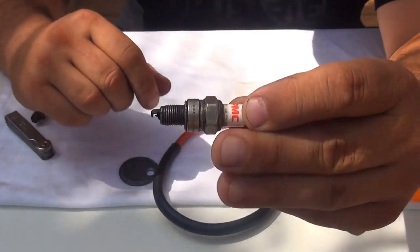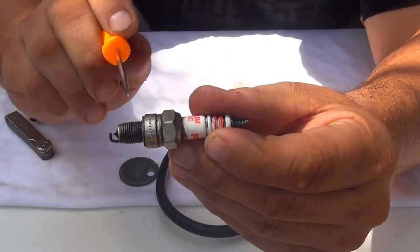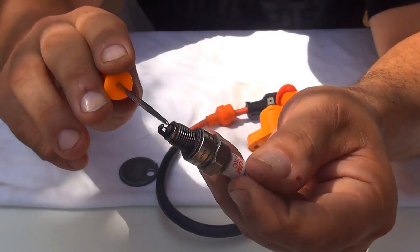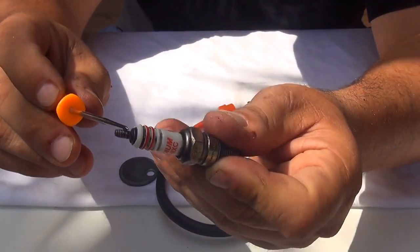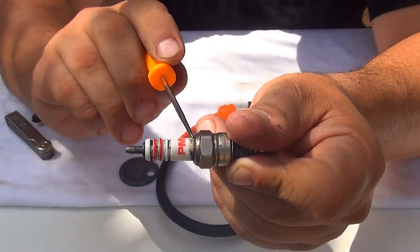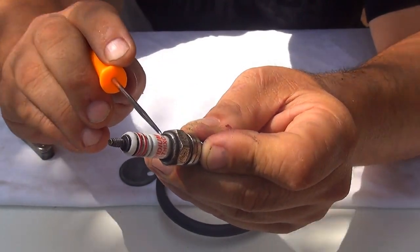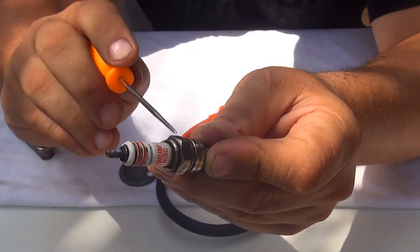This spark plug has a very easy and simple design. Right here is the ground part of the spark plug — this is the ground electrode. The center part is the positive side, the center electrode. At the top of the spark plug it connects to the positive terminal here. This outer part is the ground, and this is the porcelain insulation. Sometimes the porcelain can break from heat or if you drop it — you may not see a crack, but if it is cracked it can discharge electricity on the side of the spark plug rather than inside the engine.